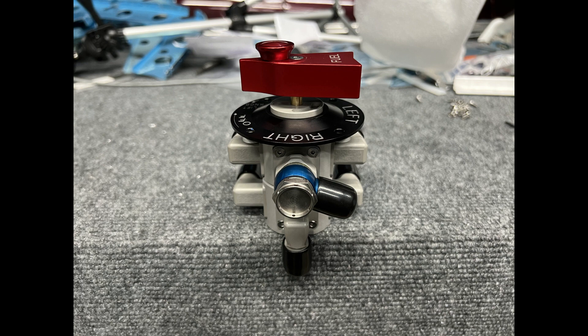Here's an up-close shot of the banjo fitting. You can see it can rotate 360 degrees. I selected it for my fuel send line because I want it to go forward and down — being able to rotate that fitting anywhere I need gives me more options for routing lines and mounting my fuel pump. The 90-degree fitting on the bottom is pointing down. Looking at the front of the fuel selector — even though it says Left, Right, Off — Left is all the way left, and Forward selects the right tank, which seems counterintuitive, but that's how it works.